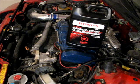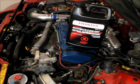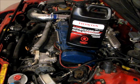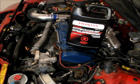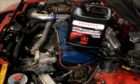You can use water from the tap when you're mixing with antifreeze, but it's definitely better to mix with distilled water. That's not spring water or mineral water that you get at the grocery store, but actual distilled water that has no mineral content in it. The reason is that the water from your tap, or mineral water or spring water that you might get at a grocery store in a jug, will have minerals in it, and those will probably end up accumulating on the inside of your water lines in the engine, and it's better to keep those clear.